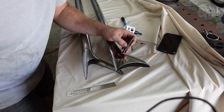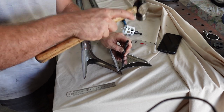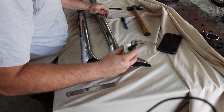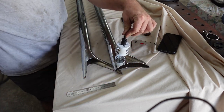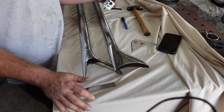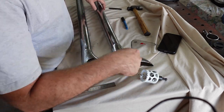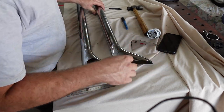Relax, show, and you just pop this in the center where your hole's gonna be, just like that. And then you drill your hole, that goes in there like that. Do that both sides, and then you just come in and cut this with a grinder. You can get all these little bits with a grinder. And that'll be that. I reckon I'll go through and I'll drill these holes, and then we'll come through and cut them out. And then I'll show you how we go through and fix it all up.